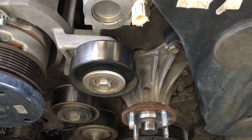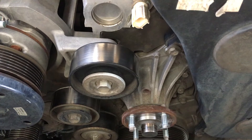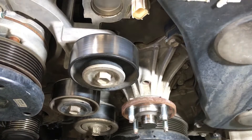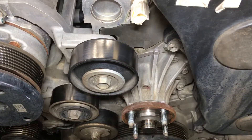So, water pumps - they're quite common, they leak a lot on many cars. They're kind of a wear and tear item. The bearing wears, the seal leaks internally, so you don't actually see a leak. It's quite obvious a lot of the time. Here we've got the light in there, looking at the water pump at the top, and every which way you'd be looking at it you're going, oh yeah, nah, my water pump's cool.